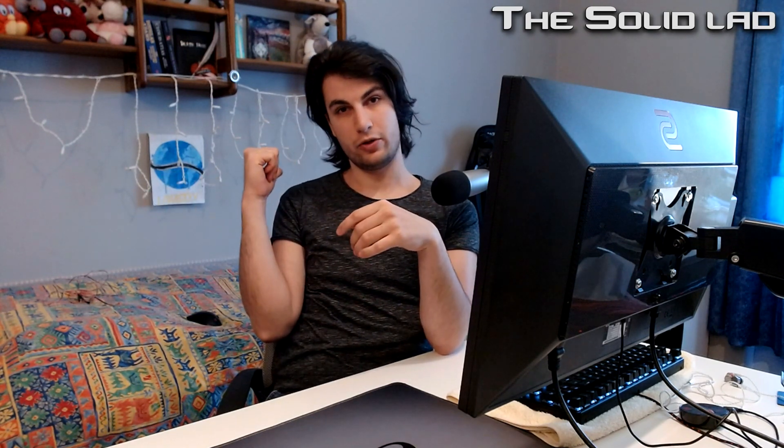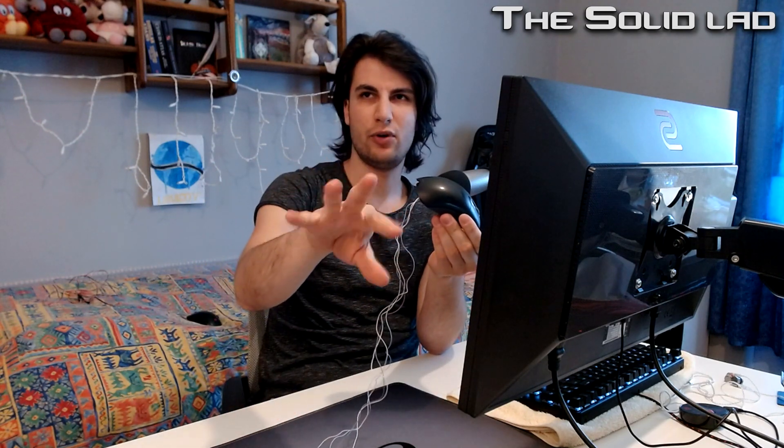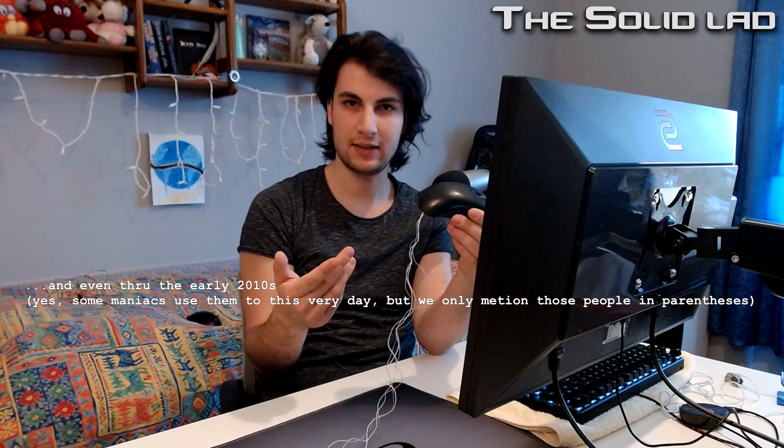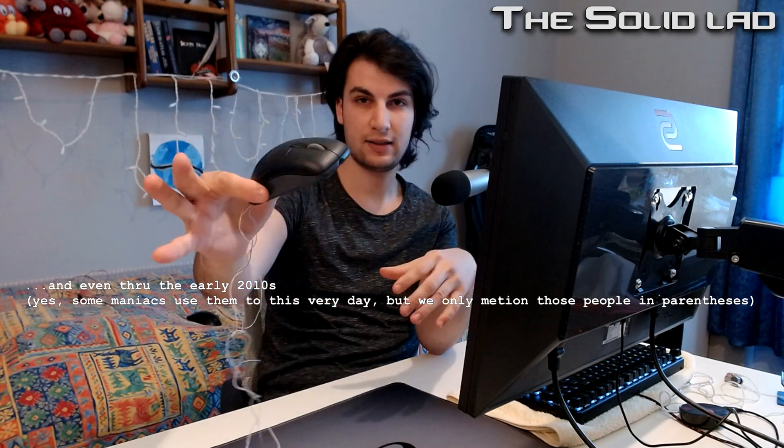What if we get my cheap solution — the cable from AliExpress or eBay — do all the things I do in that video, but with one change: we attach the cable in a way that it comes out of the back. This is a wheel mouse optical, which was used by a lot of pro players back in the day in both CS and Quake, and basically any FPS from the late 90s to the mid 2000s, when there weren't really a whole lot of gaming mice around with good sensors. People used these office mice which happened to have good sensors in them. The only problem is that it has a low maximum tracking speed, so if you try to swipe around really fast on your mousepad, the mouse will just negatively accelerate — it will decelerate on really fast turns.